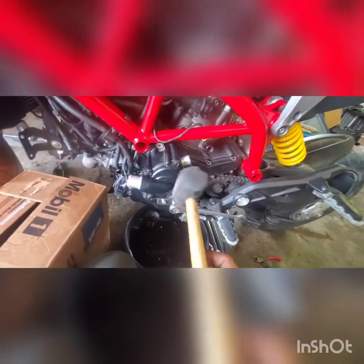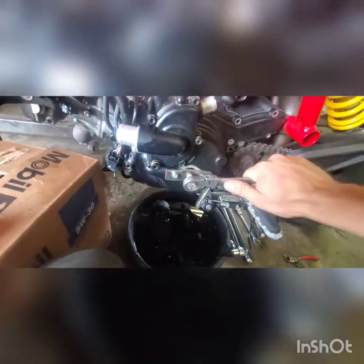I've got my puller set up. Got the small bolts in there — put them snug, you don't have to crank them down. All your pulling action comes from the larger bolt. I believe they're M8 bolts. I've also got a big rubber mallet to help break stuff loose when you get tension on it. That silicone has a lot of holding power, so I'll go a quarter turn or so — it's just started to pop loose. Leave the tension on it. A couple cracks there.